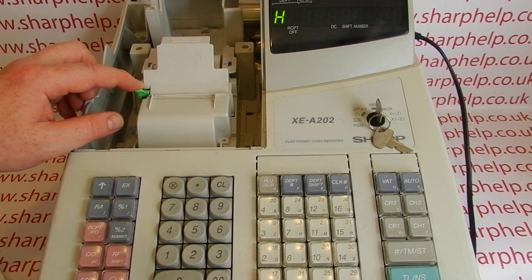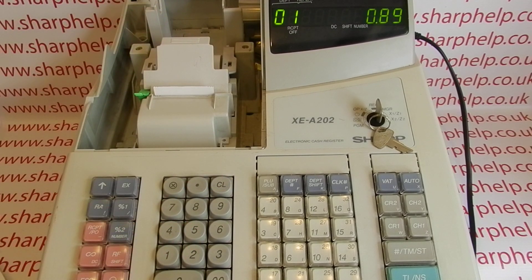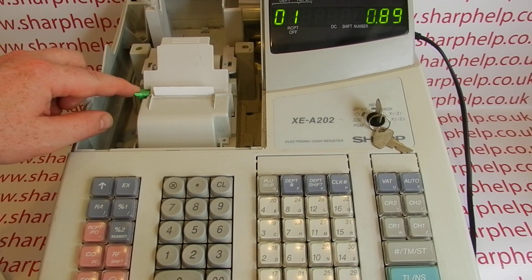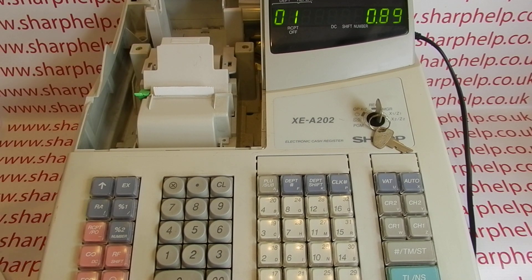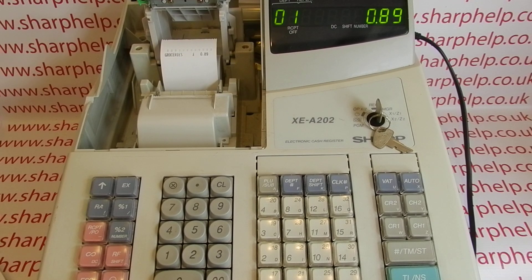What you need to check is this lever here. Everything looked correct, and I just pushed the platen arm gently down — and you will have heard it click. That click was just the platen arm fixing into place. You'll get the error message when the head is up like that.